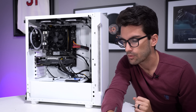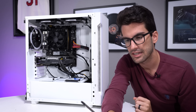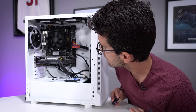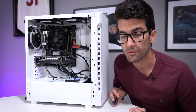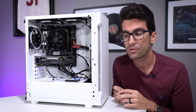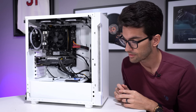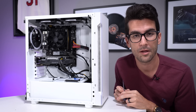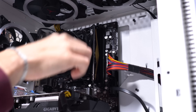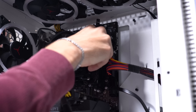So I'm going to check a few other things. First, I'm going to check RAM — see if he has seated his memory module properly. He's just got one in here. If we can get the system working, I'll upgrade him to two DIMMs, which will benefit him with this Ryzen CPU. The other thing I want to check is to reset the CMOS. If that fixes it, great — it's a minimal effort solution, though I have my doubts. To rule out a potential RAM issue, I'm going to swap this DIMM out with one I know works from testing it in multiple systems.